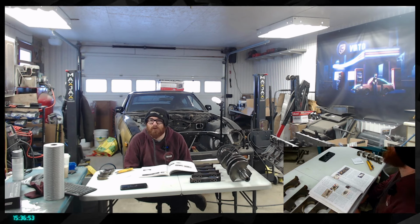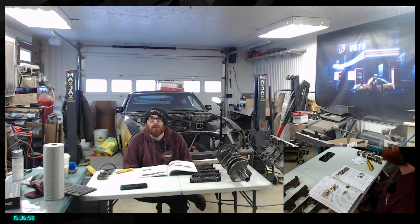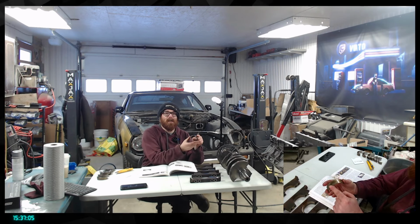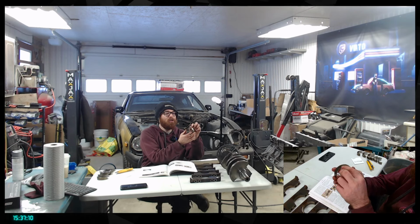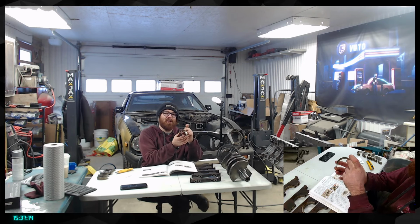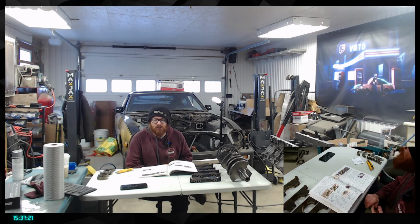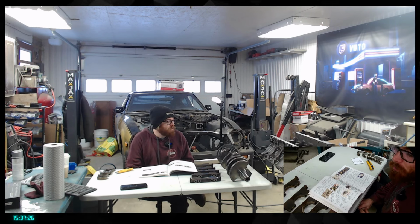Remember to always install crank bearing and rod bearing dry, only lube the crank surface. You mean like the underneath, basically I have the old one here. So you say this side here, the top, to be dry and only lube the crank so that it gets in contact with that. Yeah, it makes sense, because you need that to be dry, because you need the spacing to be good. And that's part of what we're doing right now.